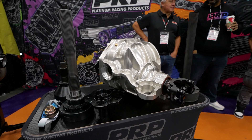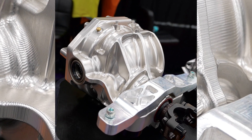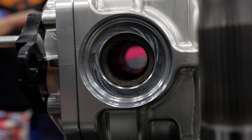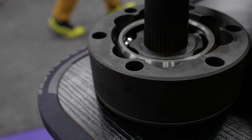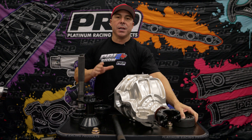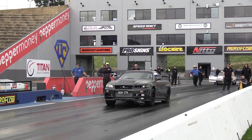We've got the diffs, and I want to talk about the diffs because we're really focusing on drivelines at the moment. We want to complete the whole driveline package with all of the options — R200, the 8.8, which also bolts into the Supra. We've got the RX-7 FD coming out soon. Then we've got our Pro Series Bad Boy. This thing is overkill — 35-spline spool by Strange. We've got our own running gear, our own axles, using 128mm Series 21 CV. Indestructible. All of this stuff is being made in preparation for street cars that are going to run 5-second quarter miles. We've already got one of these setups in Mach 34. It's going to start being the norm, so we're getting ready for 5-second street cars.